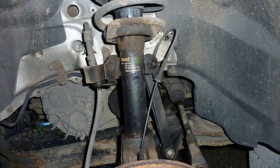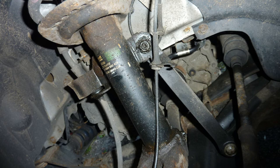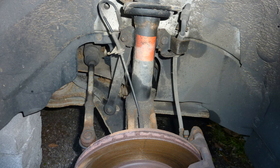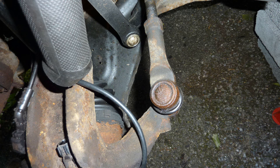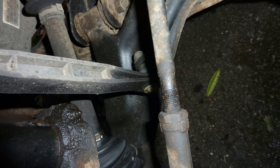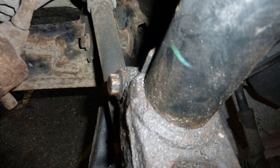Doing the brakes now. And that's strut, one of the front ones. As I was saying, you can remove that ECU without really having to take that brace off that you saw me take off. So if you're doing anything like welding or something, you just get I think it's a 7mm socket, take that off, and you could just lift up the connection to the ECU.